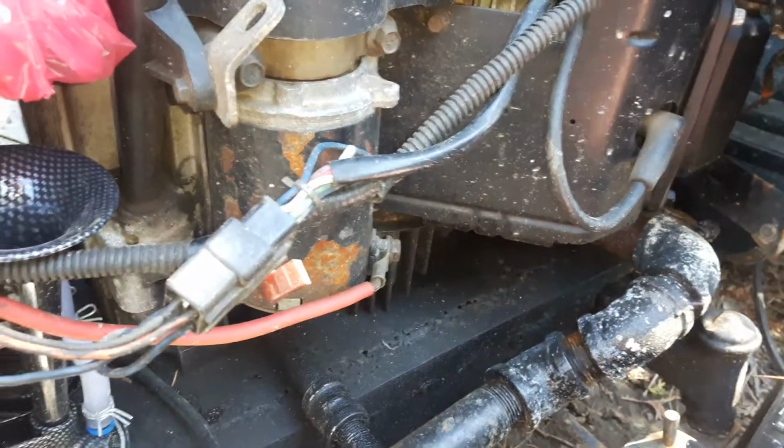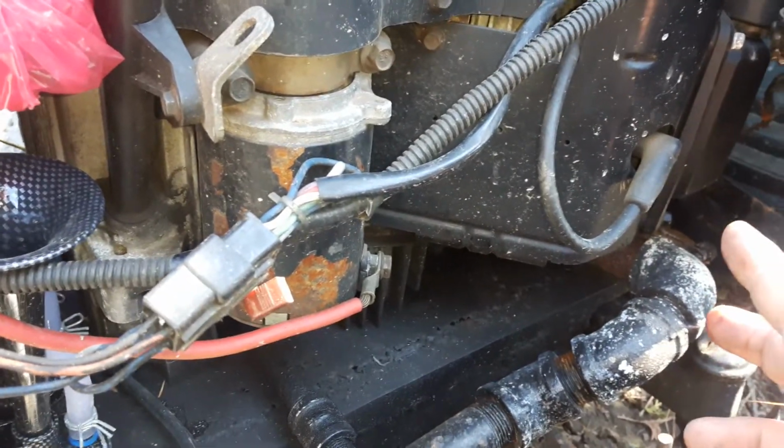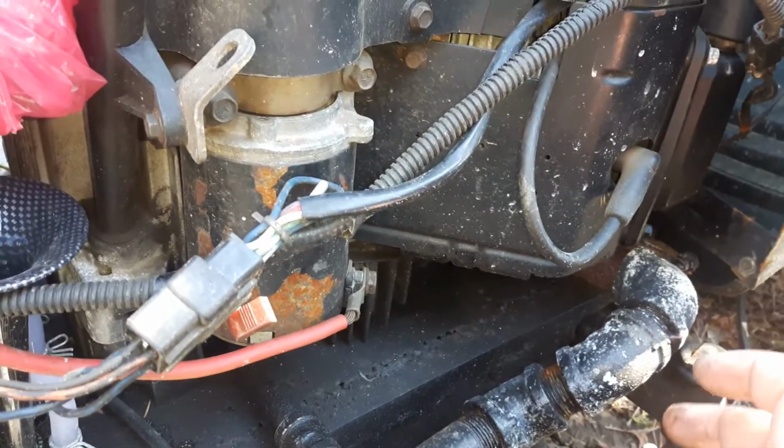So hopefully that helps you out getting oil temperature. Really, I do recommend it. On these engines, any sensor you can physically put on, I do recommend doing. So oil temperature, oil pressure, especially if you're running a modified, is a very good idea, in my opinion.